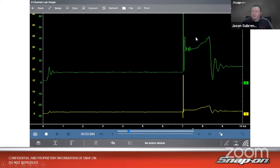And you do see quite a bit more detail on that firing, in that secondary signal, because the voltage differences are going to be much greater because of that step up factor. Right? If it's 100 to 1, 1,000 to 1, 10,000 to 1 difference, that's going to be your difference in voltage too. Right? So if I have 14 volts here and I have 14,000 volts here, possibly, depending on what it is, the ups and downs are going to be more pronounced.